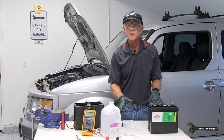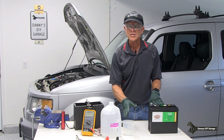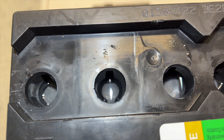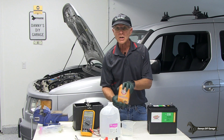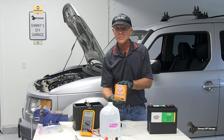This brings me to tip number three. Every six months, you'll want to pull those caps off and check the acid level. If the acid level is low, you'll want to adjust it with some distilled water. The level is adjusted correctly when you can see a quarter inch of liquid above those plates. Make sure your battery is clean before you put it in the car. If your battery has acid or corrosion on it, use water and baking soda. Baking soda is a good neutralizer for the acid — just be careful not to get any baking soda inside the caps.